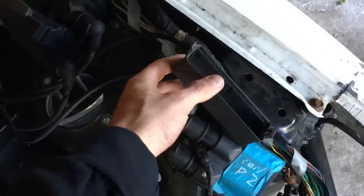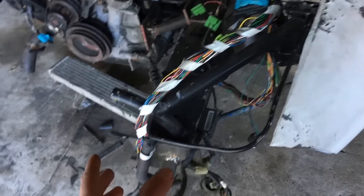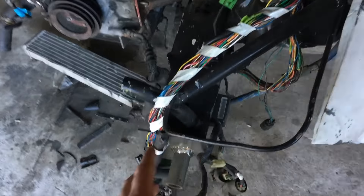I don't know much about rotary but we found those wires. We were gonna split it all apart and take the wires we need, or rewire it - but it's really hard to get the wires out because the grounds and powers all run through there. So we were just gonna get it running by taking the whole body harness out of the RX-7 and putting the whole body harness in, which kind of works because we'll be able to plug up the stock RX-7 dash. That'll give us the RX-7 tachometer, everything, so it revs to 9000 - which will be cool. After we get it running we'd like to go back through and get rid of the wires we don't need, but we don't want to cut things out and then have it not run.